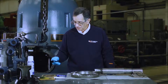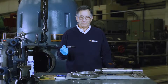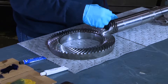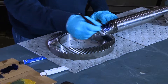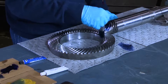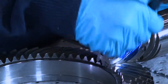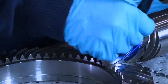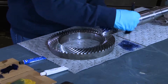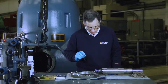I'm going to first apply the blue compound onto the pinion teeth. You put a very thin layer. And if you see it going on too thick, what you do is take some of it off the brush and keep spreading. You want to do a series of teeth, do both sides, and just keep thinning it out. And that's a pretty good pattern.